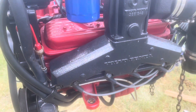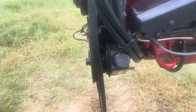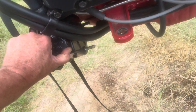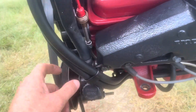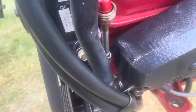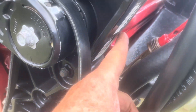I'm now going to take off the port exhaust manifold because the engine's leaning and causing me to spill the power steering fluid out. It's a weird place to put the power steering fluid at that kind of angle, and for some reason the cap's not holding tight. I'm going to take this and shift balance back to the other side. This hose is permanently clamped with a non-removable clamp — you destroy it taking it off. It was worked in behind the oil dipstick, around this bracket, and then up to the thermostat housing.